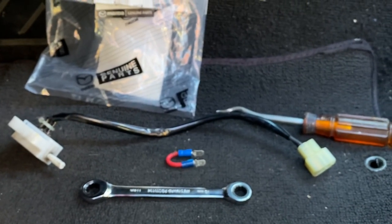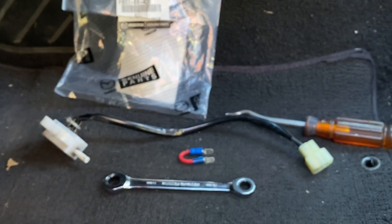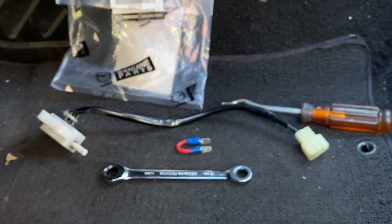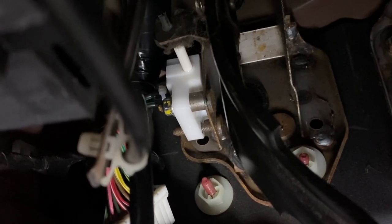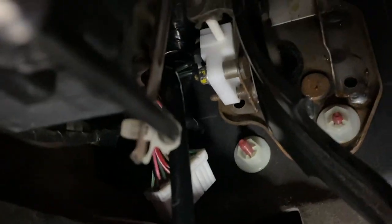I hope that shed some light on the clutch switch, the clutch switch bypass, and diagnostics. Be very careful when you undo the clutch switch — if you are removing it — not to drop the little 10mm bolt or the little metal sleeve that goes behind it. Right there in the middle of the frame you can see there's a little metal barrel that goes in between the plastic of the clutch switch and the bracket it attaches to, and there's a little 10mm nut with some yellow paint on it. Just be very careful not to drop those because if you do, they're probably going to go right behind this plastic kick panel and you'll probably never see either one of them ever again.